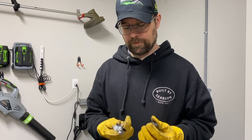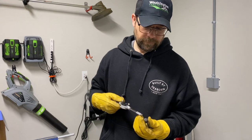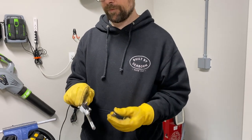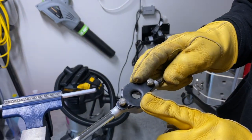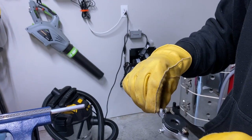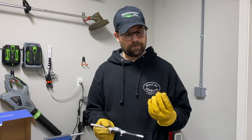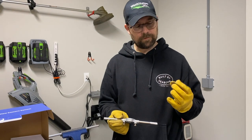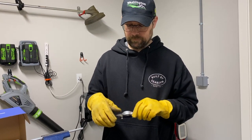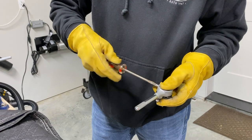I've got my die set here. This is a 3/8 inch die for the 3/8 inch rod. It says you're supposed to start it on the side with the lettering, which for this one, it's got this little guide that you can set the aperture in there to the diameter of your rod. And in theory, it's supposed to keep it level. At least that's what I understand from the directions. I have heard that you're not supposed to use the hexagonal dies for actually cutting new threads, but this set says you can, so I'm doing that. But this drops in there. It seemed to work with the steel. Everything went fine. So I'm pretty sure it's gonna work with the aluminum.